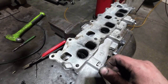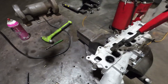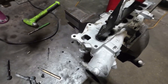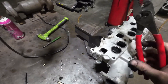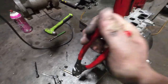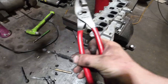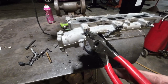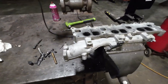I'm going to keep going on removing these swirl flaps. You literally just grab a hold of the flap like this and twist the metal part of the flap off. Then once you have all that ripped off, don't worry I'll go back and clean up the surface after. Once you get all that ripped off, you can come and pull the spool out. And then afterward I'm going to try to tap these holes and just put plugs in. If that doesn't work, we're going to use JB Weld.